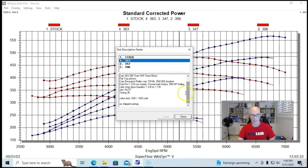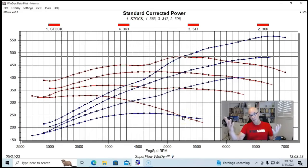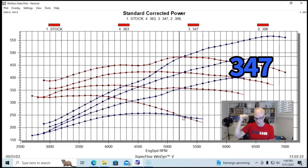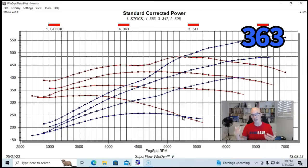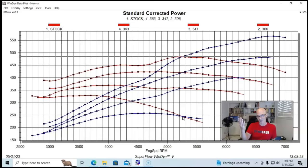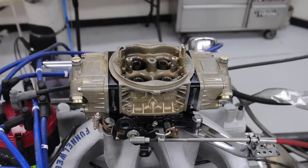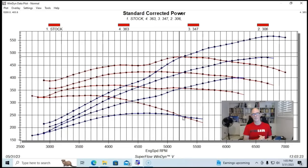After all that, our 363 produced 566 horsepower and 484 foot pounds of torque. You can see we've stepped up from the stock 302, to the modified 306, to the modified 347, and finally to the modified 363. Not only did we step up in displacement on each one, we stepped up in specific output by changing the things that matter — compression, cam timing, and in some cases intake manifold and carburetor. I'm Richard Oldner — make sure to like, share, subscribe, ring the bell. More testing coming up.